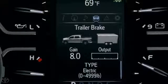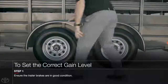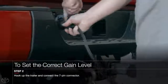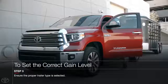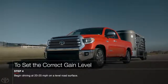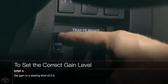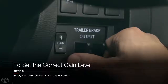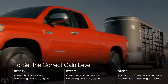You'll need to set the appropriate gain amount every time the vehicle load, trailer load, road condition, or weather changes. To do this, first make sure that the trailer brakes are in good working condition and functioning normally. Next, hook up the trailer and make the proper electrical connections, and be sure to select the correct type of trailer brakes. Once hooked up, drive on a level road surface at approximately 20 to 25 miles per hour. Using the gain selection buttons, set a starting gain of 5. While still driving, apply the manual trailer brake output slider, then use the gain selection buttons to either increase or decrease the gain to just below the point of trailer wheel lockup.